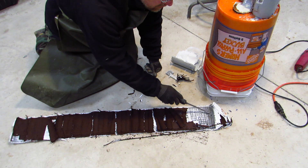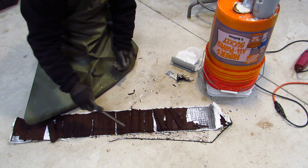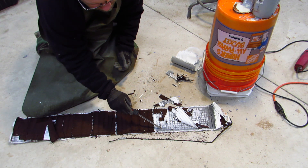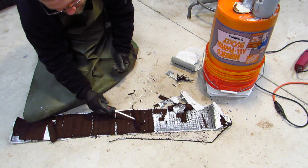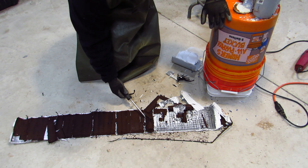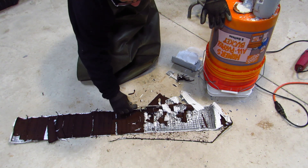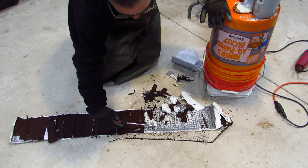See that gray right there — that's what they should look like. So you have a lead plate, then a fiberglass layer, and then a lead plate under that. That plate there looks a lot better — see how it's gray? So I think it's safe to say that this is why the battery quit working. It should be holding together like this bottom plate here.